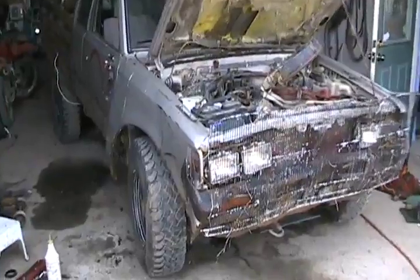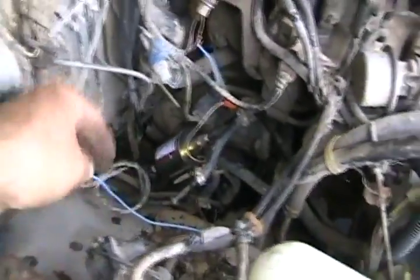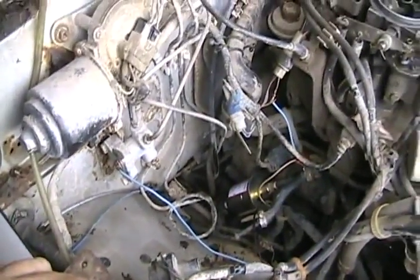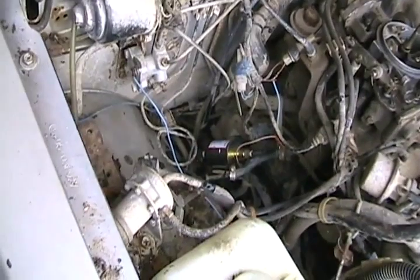It's alive! So the first part of the fuel system is an inline fuel pump I installed below the carburetor — just cut the hoses. Wired it into the wire that works the solenoid that shuts the fuel off to the idle circuit of the carburetor, and the other one to ground. A tuber who visited a couple years ago donated that brand new — especially for this truck, because you need the low-pressure inline fuel pump, not made for fuel injection. You can hear it — it works by making little pulses; it doesn't have a spinning electric motor.